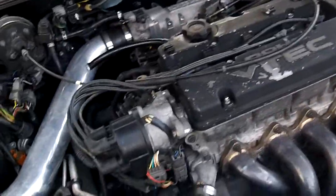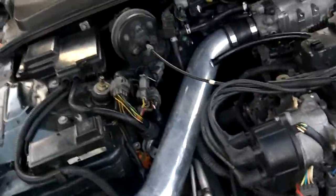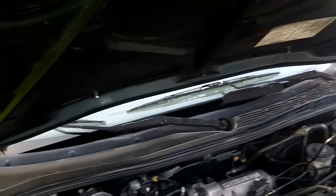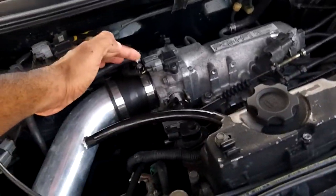I had to retard the timing to get it to run a little bit better. It's not running perfect — it lags horribly in the low end, but it moves really fast in the high end, especially when VTEC kicks in. I had to put in a new starter, new front mount, new Hasport mount, 97-01 H22 throttle body. This is the OBD-1 motor. Newer distributor cap, newer throttle position sensor, new MAP sensor. This thing has a lot of new items — new timing belt.